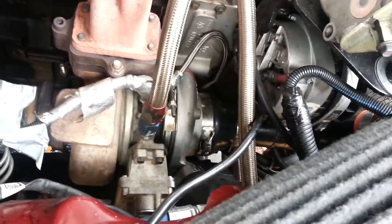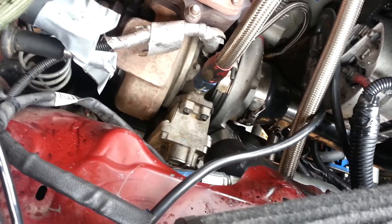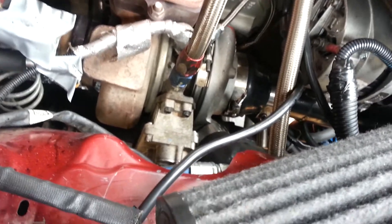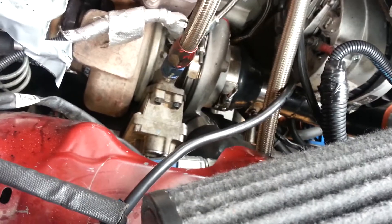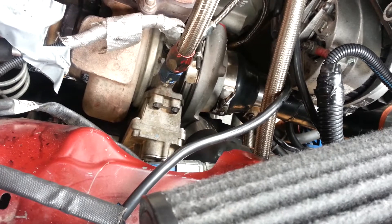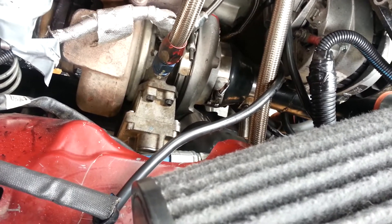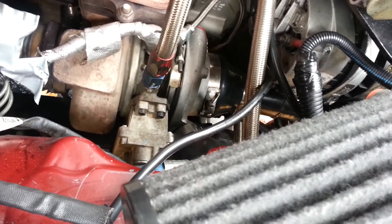I just finished it up today. I got on the interstate at about 60mph and made about 25 pounds of boost. I didn't really get on it too hard, but it definitely lit up a lot easier than the 60mm wheel on the HE351. It's a lot easier to sustain like high 20s to 25 pounds of boost.